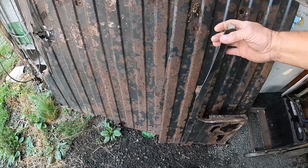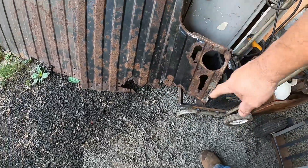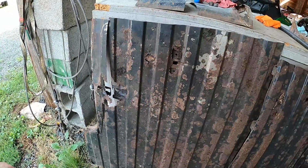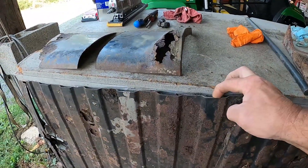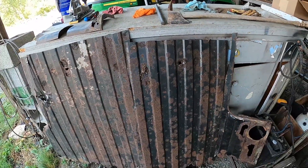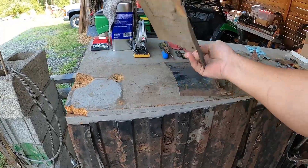Here's all the rusted-out internal pieces — that's where the fuel tank filler is, and it was all rusted out. The whole back was completely rusted out along the back edge, along the tailgate. Here's along the other fender well — the frame pieces were completely rusted out where the bolts go through. But in front of that it was all solid metal, just had top surface rust. Got the rusted-out pieces completely removed and put in new metal. The outer rear piece on this one was completely gone.